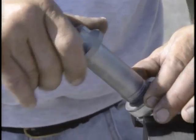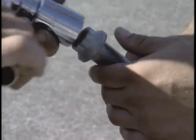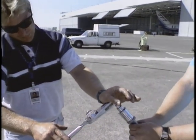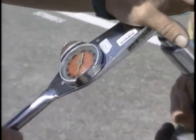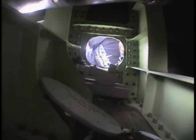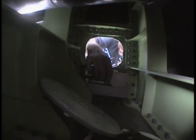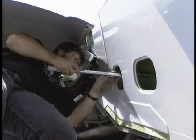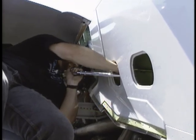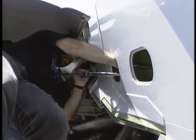Use only new mounting bolts or bolts that you have examined. The nuts are held in place by nut retainers. First tighten all bolts to half the specified torque, then tighten each bolt to the final torque.